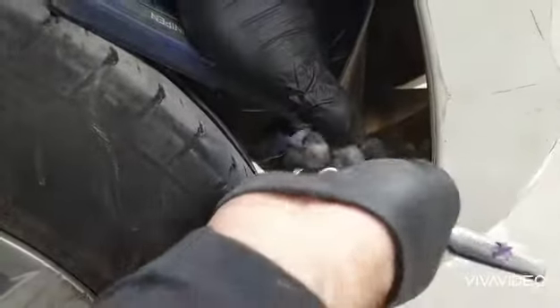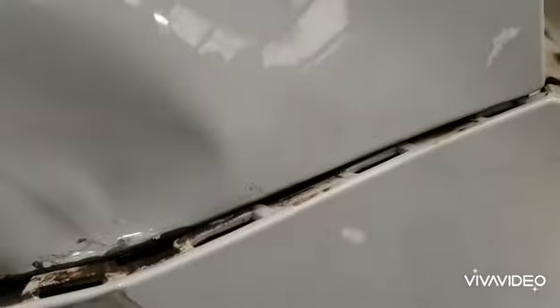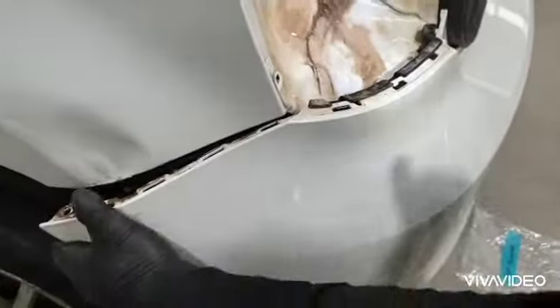This one I'll move the guard liner to the left and take that one out - so when refitting it will be easier to put it back in the correct position. It's all held on by a bumper bracket which is behind. Slowly just push it out of the clips, then what I like to do on the top here is grab a pry bar and push these inserts downwards and pull the bar towards us with the tailgate open. We earlier took off the lamps, which you can see in one of our previous videos.